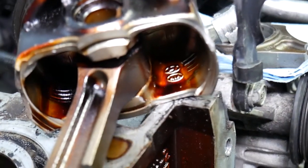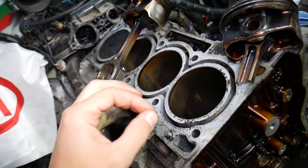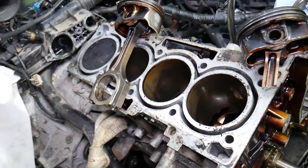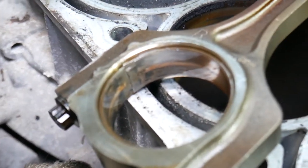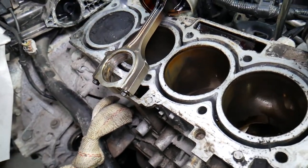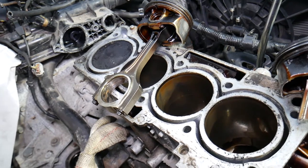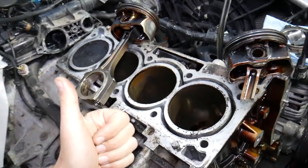You can even see the Hyundai and Kia logo on the piston right here. If you ignore the knock, you will not get far. Once you hear the knock, stop the car in a safe place — just a few seconds or minutes of continued driving can cause quite a bit of additional damage. What causes rod bearing wear? Not changing your oil regularly, or not using good quality oil — old oil doesn't lubricate bearings correctly. Also, on cold days, let the car warm up before driving, and do not rev the engine when it's cold. Hopefully this video is helpful — thank you for watching and see you next time.